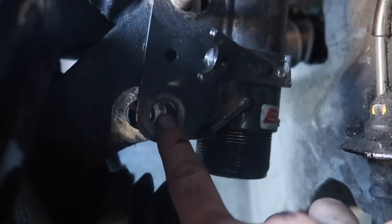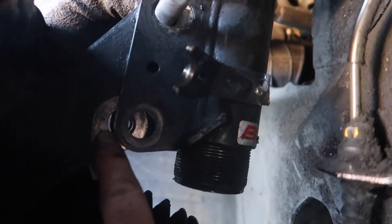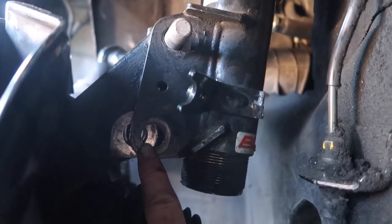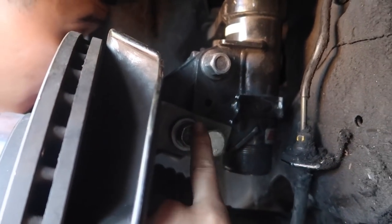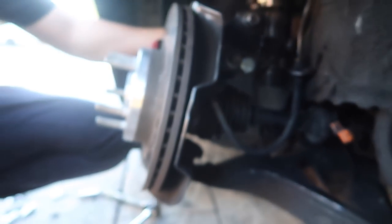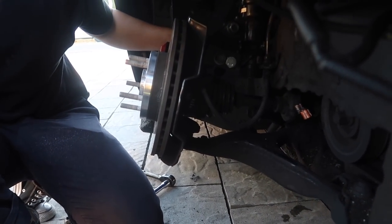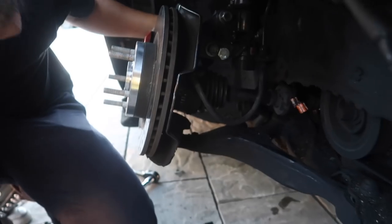But imagine from here all the way when I put the plate — from here to out there — it's gonna give me at least five degrees. It's like half an inch to an inch and from here to here that's a very big difference for sure. So after we put on the plate, it's gonna be something like this: the top coilovers and then the bottom one, and now the plate is pushing the knuckle out. You can see my rotor right here — I would say this is at least negative 10, double digits for sure. I'd say negative 10 to 12.